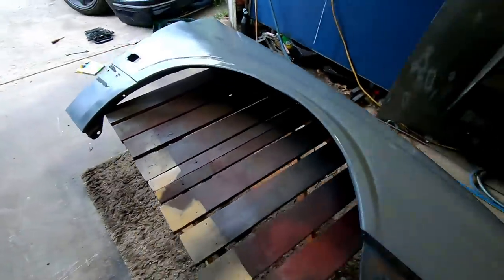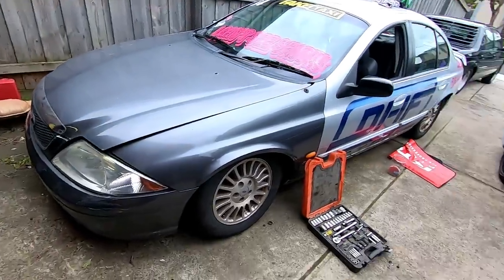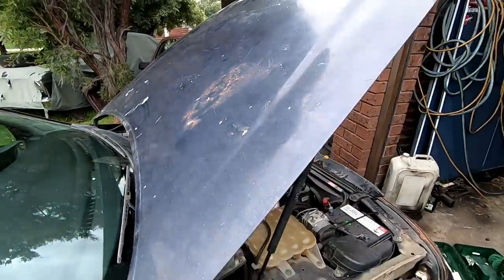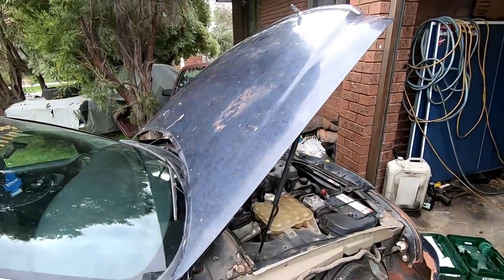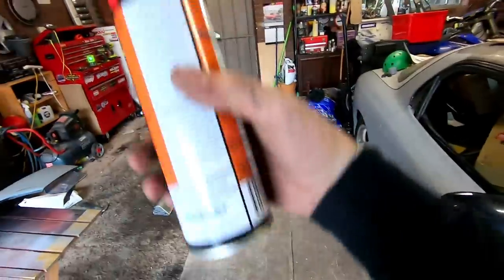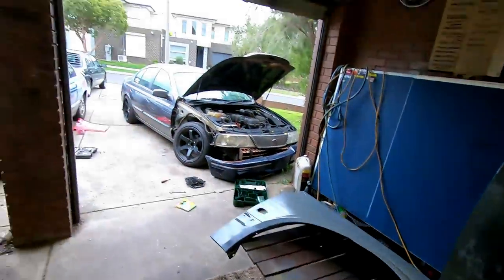So I'll let the epoxy flash off, hit it one more coat because there's a couple of tiger stripes there I can see. I'll whack some top coat on it — hopefully we've mixed it right. The bonnet we're going to do black so we don't have to worry about that. If I rattle can that it'll tiger stripe the hell out of it. Also forgot to mention that we have the Concept Paints clear as well. I don't think I'm going to worry too much about rubbing the clear back to get a nice finish — it's going to be pretty orange peely but who cares.